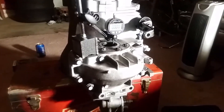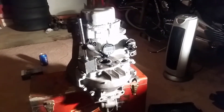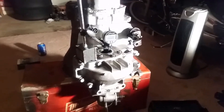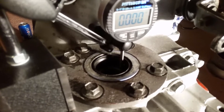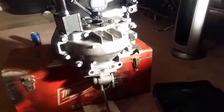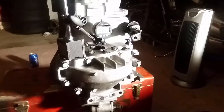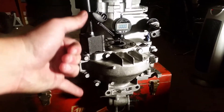The way you do this is you need to tilt the transmission over towards vertical, place the differential in here, tighten it down, and then set this dial indicator up on the very edge of it. In the bottom I have a long extension going through and contacting the ring gear inside. You push up on this extension and it gives you how much end play — how much the differential inside is moving.